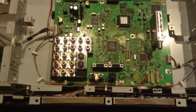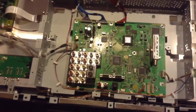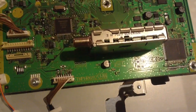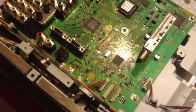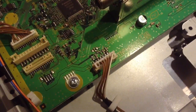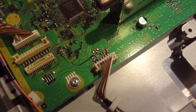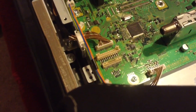I couldn't see anything physically wrong with the board, but I know that something between the HDMI ports and the logic processor has failed. I looked at the board very closely and found the model number. For this particular TV, the model number is TNPH0692. For some reason, there are multiple versions of this board — it's called a suffix. It's unclear to me if the suffix matters, but because certain retailers were offering to match the suffix, I went ahead and got the right one. If you look very closely, you can see headers with the letters AB, AC, AD, AE, AF, AG, and AH, and there's a resistor bridging the AF connection. So in this case, it's a TNPH0692AF model.